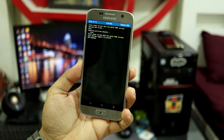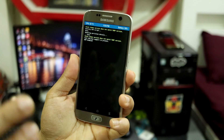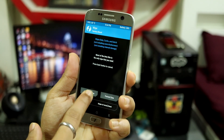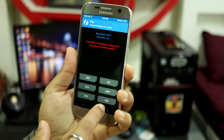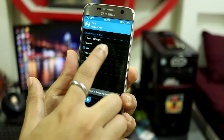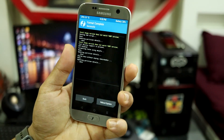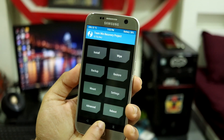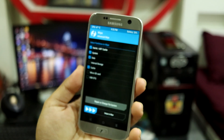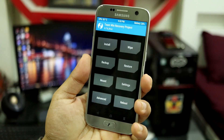This is the third time installing — I'm changing AROMA options to see what changes. The error that comes up on first install is about the data and cache partitions. First, go to the cache partition and change the file system to ext4. Then go into data, select repair/resize, and change the file system to F2FS — it's better when using One UI ROMs or GSI-based ROMs. After doing that, your errors will be resolved. Then wipe your partitions and click Yes — everything will be fine.